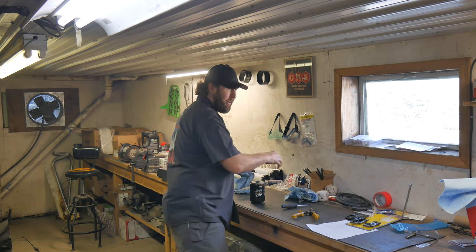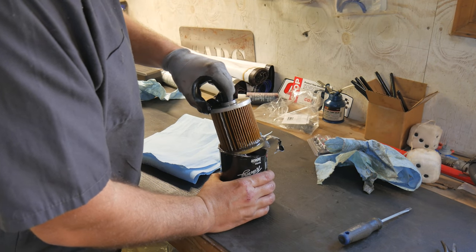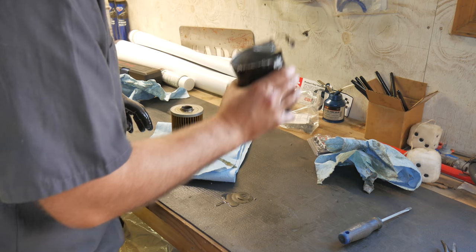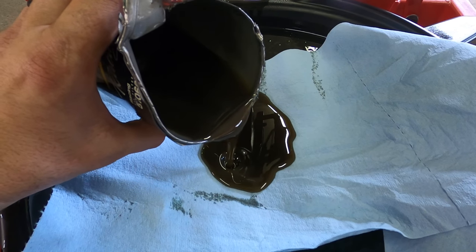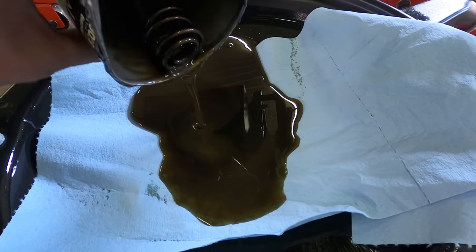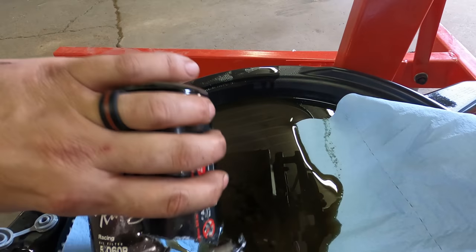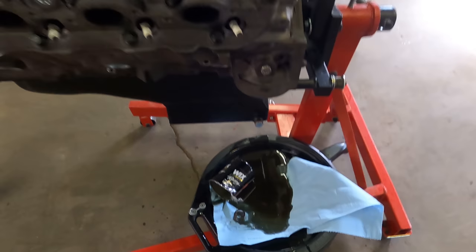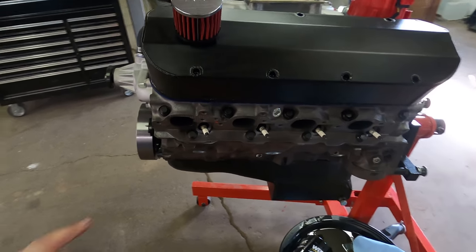Let's take a look in here and see what we got. Nice, thick, heavy filter element here. We'll dump this out and take a look. Just a little bit of flake, but not bad at all - just the tiniest amount of flake. So great news - we're safe, it's healthy, it's happy. The bearings are fine. The rings did come in. So we're off to checking the spark plugs.